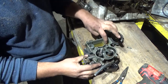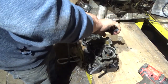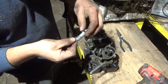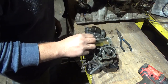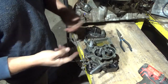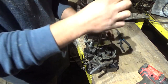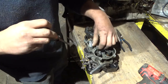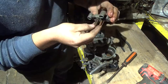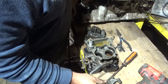You can see the fuel bowl is full. But the accelerator pump's not spraying again. The accelerator pump's not torn or anything. And it stopped up again. Whenever you push this down and you see it spray back here, it's stopped up. I already know that. The 2 times that I've already done this to this carburetor, I've cleaned it out, and I really have no idea what keeps stopping these holes up. The bottom's clean. So there you have it. These 2 nozzles are clogged up once again. You might not be able to see it in the video, but there are the nozzles, and they're clogged up.